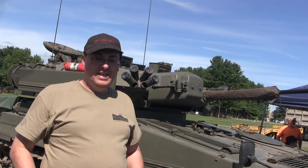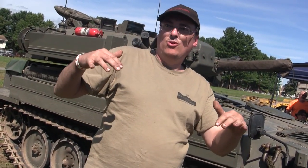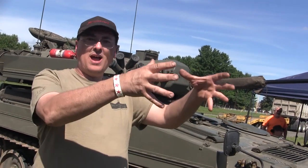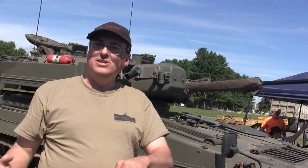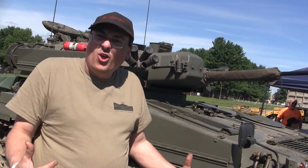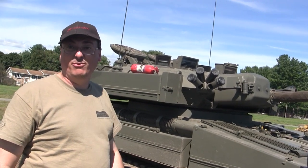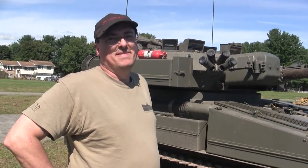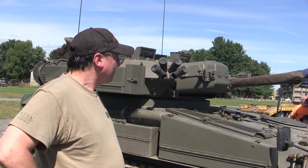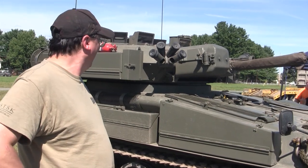They have to be held up because when you kick down, you go from 4 to 3, it stands on its nose because the transmission has a high pressure and a low pressure. When you go from 4 to 3, you're going from high to low, so it really stops the vehicle. You're supposed to slow down a lot before you do that. You can lose your teeth because metal doesn't give. No, it don't. The aluminium armor on that thing is a little bit stronger than your gum line. But otherwise it's loads of fun.